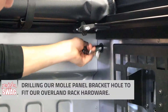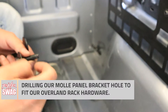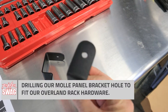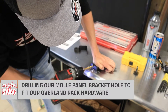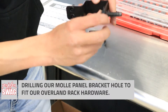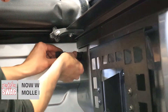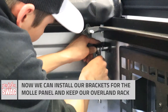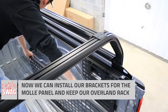Now, with our Overland rack setup, the one issue we did run into is the hardware does not thread through the bracket setup. As you can see, they supply a rubber washer setup initially, but with the Overland rack there's a little bit bigger bolt that goes through. A quick fix to this was drilling the bracket out to fit our hardware — quick and easy, and we're on our way. Go ahead and thread that bolt back through your Overland bracket. It's the same on the other side, so drill the hole the same size, go ahead and install your hardware, and snug it down.